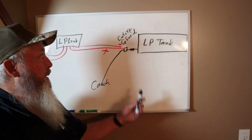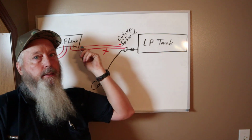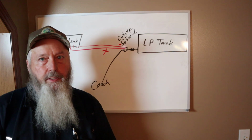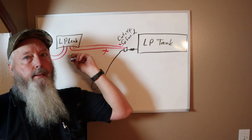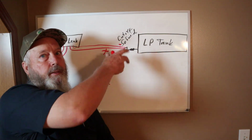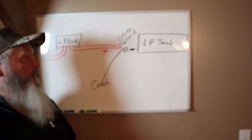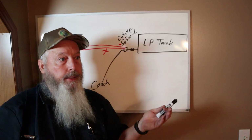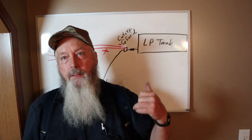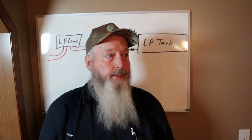She understood, because like I say, what we done was took it from one that automatically shuts the gas off if it detects a leak, to, like most of them that we see, if the LP leak detector goes off and senses a leak, you got to run around and physically cut the gas off. That's the way most of them are anyway. So they're cool with that. Apparently it is not any kind of code, because like I say, most of them I see don't even have the solenoid, or it's been deleted already before I ever get to it.